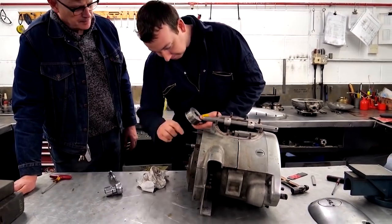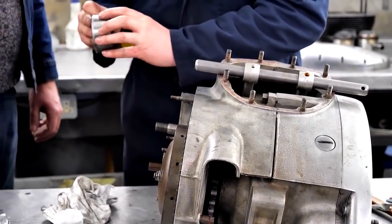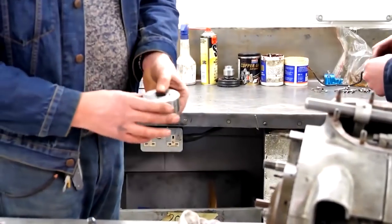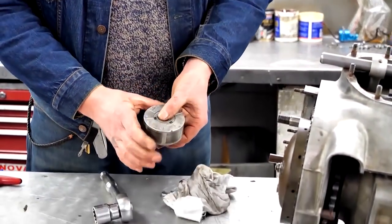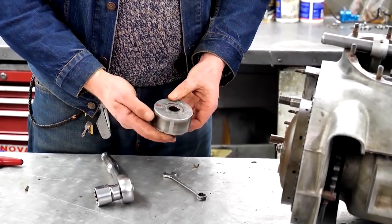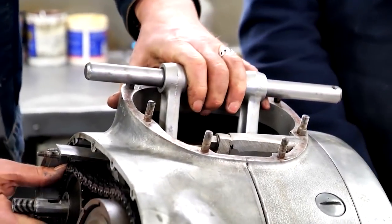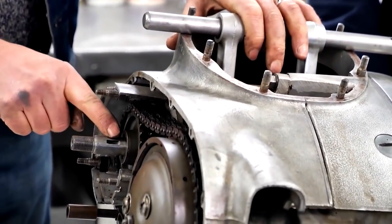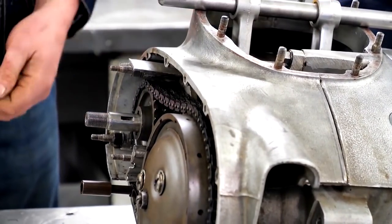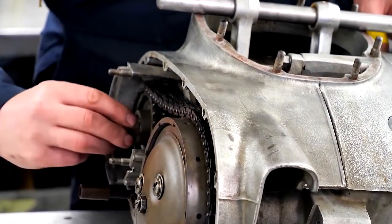Nice snug fit, which is nice. Another problem you quite often get with these alternators is that the centre of the rotor — the rotating magnet — is a steel part cast into the aluminium, and sometimes that actually works loose, so you get a bit of movement on that. That makes it very clonky and it's quite damaging to the bearings of the engine. There's a keyway here that locates it, and if it chatters it can wear that keyway until it needs to be welded up and remachined. That's the only real way around that. This one looks okay.